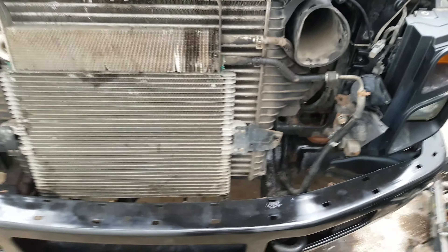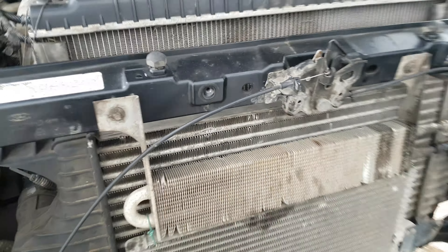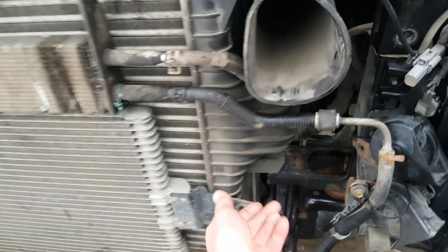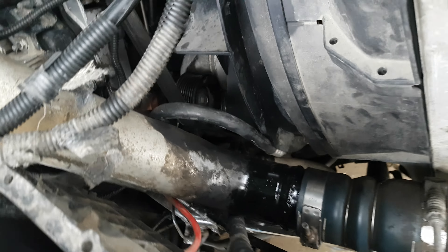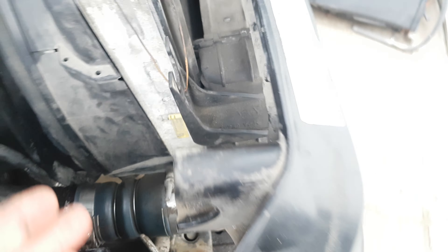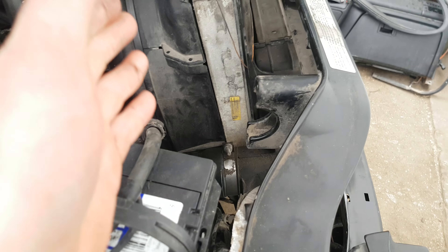It's running and driving now — everything's full of fluid and hooked up. But I do have to make some sort of mount at the bottom to hold up the radiator, and then something to hold the intercooler. These intercooler hose pipes here, you have to lengthen them a little bit because everything sits tilted anyway.